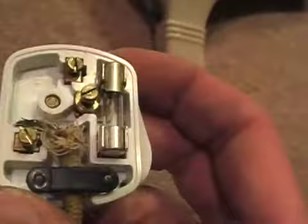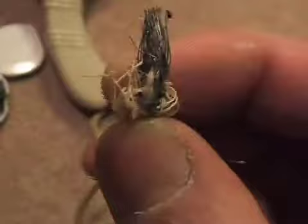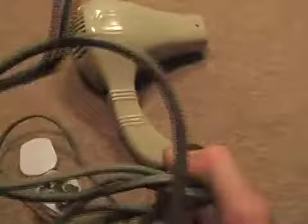It's not really a good idea to plug this into the wall at the moment because the insulation is rubber and it has perished, which is quite typical of old flexes. So for the time being I'm going to put in a bit of flex I can find that isn't rubber, but first of all let's have a look inside.